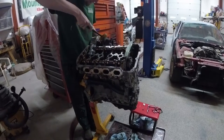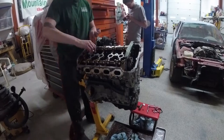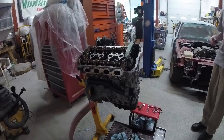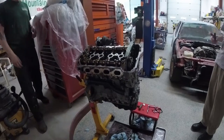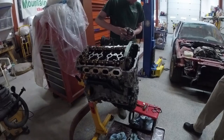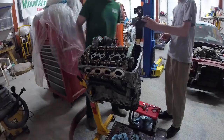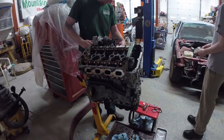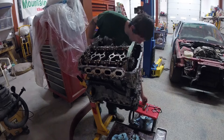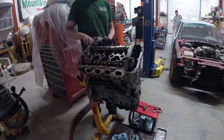The cold side volute needed some adjustment, so that had to come back off. You can take the cold side off and the hot side off with it still on the car. So what you do when that happens is you separate the whole cassette — I just took the whole cassette off. Now it's going to go back in because I had something misaligned there. Easy enough to get it misaligned, easy enough to fix it, especially while it's out of the car. A little bit harder to do while it's in the car, but still not bad — it is not a hard thing to fix.